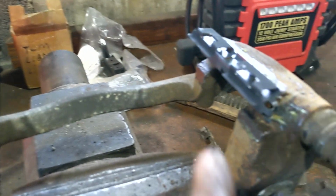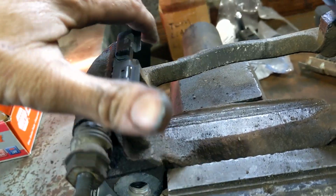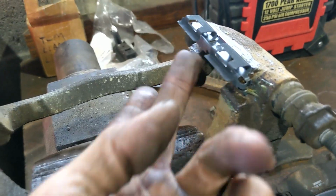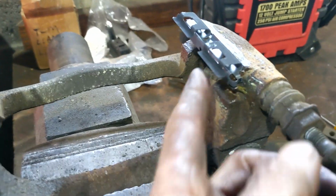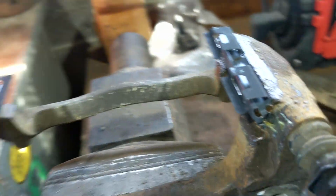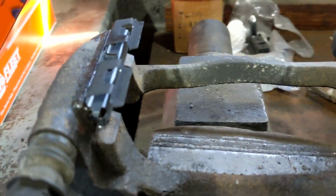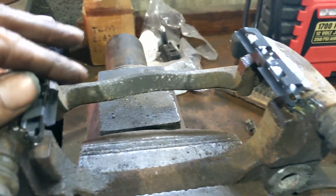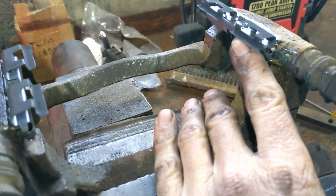And one thing I'm going to do is I want to get a little bit of grease just on this rail here of these clips. Anywhere that metal meets metal, I like to put grease. Some mechanics say, oh, you don't need to do that. But you know what? I'm going to do it. I always go on the side of caution, and it prevents some squeaks, and it's also going to help us slide those pads in a little bit easier.